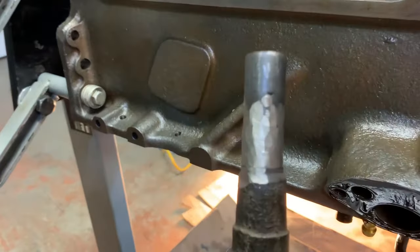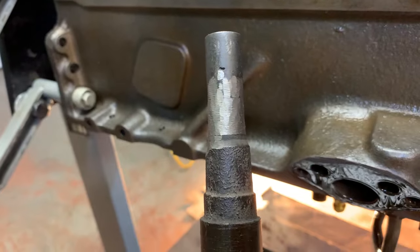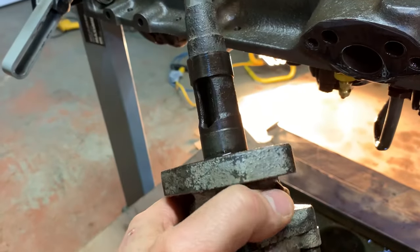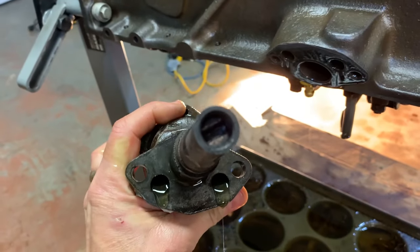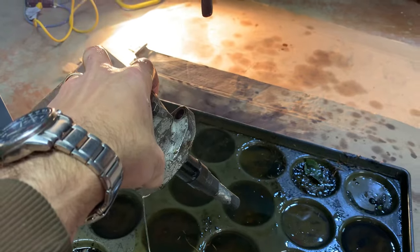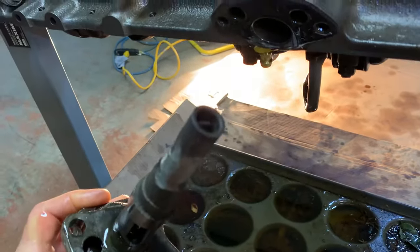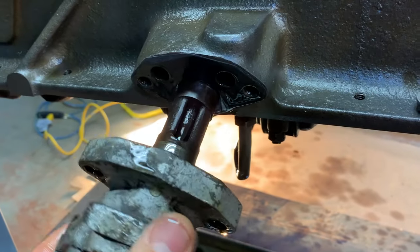You can see there's supposed to be a gear on the end there. I ground it off completely with my hand grinder. It's the old pump. It makes good pressure though. It was a good pump. Not bad, good spare. And see a little tang inside of there? That little slot? I'll take my piece of steel that I hand filed to match that slot, and I'll just use it to drive the oil pump through my drill there, right?